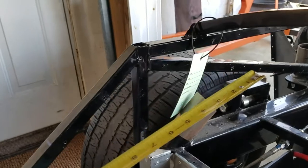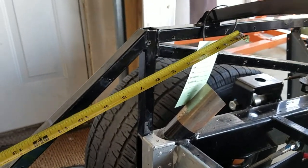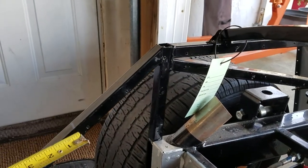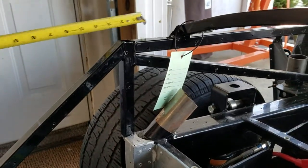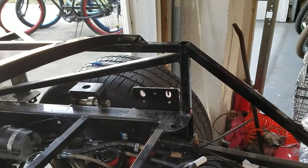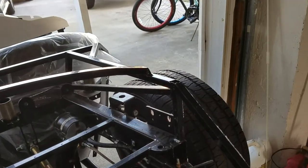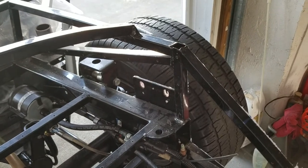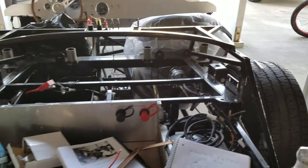Then I'll be able to check in here and see in the body to make sure that I can put in a 3¼ inch rectangular square tubing that would be able to be welded in place and clear the body. I'll be able to look at that with the body on here. Once I see that there's a gap large enough to put that 3¼ inch square tubing back in, I'll take the body off and weld that in place.